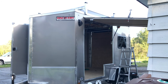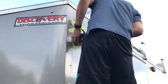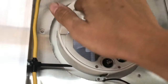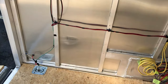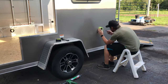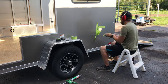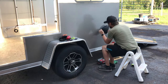The forward vent I already removed in a previous episode - I replaced it with a Max Air bathroom dome fan. That converted an uncontrolled opening into something I can open and close as needed. The electrical box on the driver's side with the batteries, inverter charger, and solar controller is going to get warm, especially when using the charger inverter, so anything I can do to get that heat out will make it easier to condition the rest of the interior.